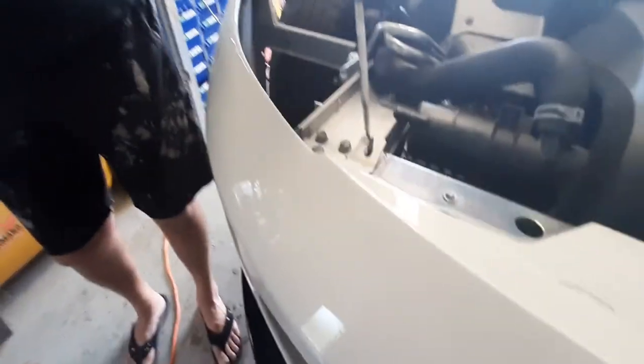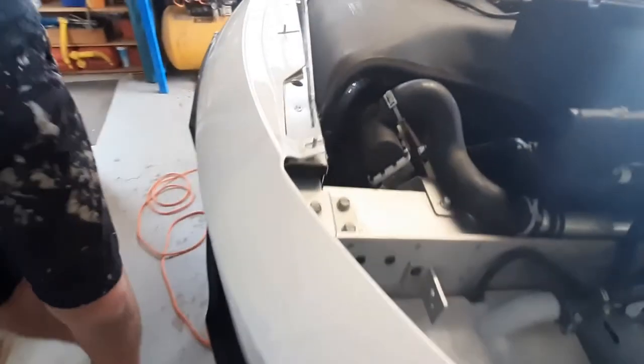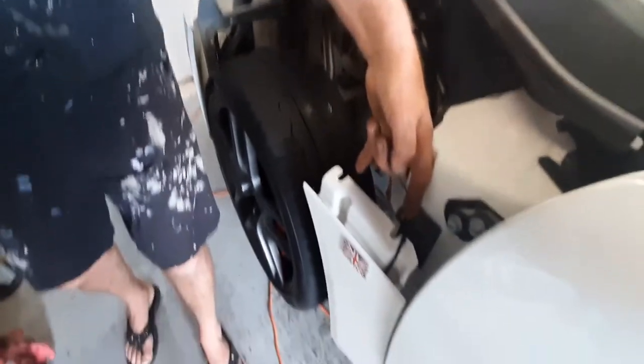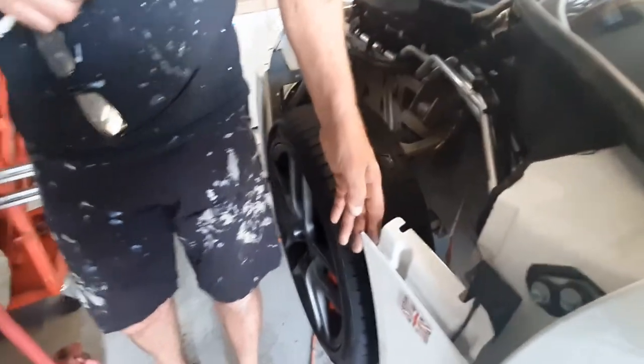The headlight normally goes in here, so this is the headlight position. There's a fastener under there, which is actually underneath the clam, so the clam normally is there, and you sort of have to get that in there. And then there's the well-known one underneath the Lotus badge. So that's the Lotus badge one, and back to the other side. So that one's hidden there, so the clam effectively is there. Headlight, 1, 2, 3, 4. We're on the left-hand side of the car. Two in the A panel, and one in this little one. I've cable-tied these on just to hold them in place because I've been walking back and forwards, and the last thing I want to do is catch one of these and snap it off.